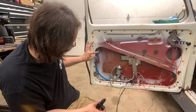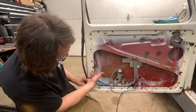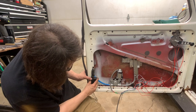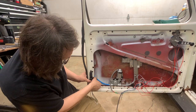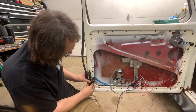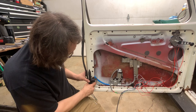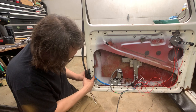We can get started on the servo mount. The servo needs to be mounted low enough that it doesn't interfere with the window track mount, so I'm going to extend the servo fully and make sure it drops down low enough. I found that if I center the servo portion with this new tab I added for the windows, that gives me plenty of clearance on the top side. Now we just need to make a plate to mount the servo to that will mount in the door — I want the servo all the way out to the outside edge.